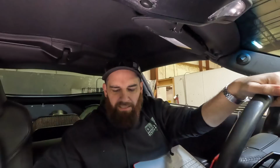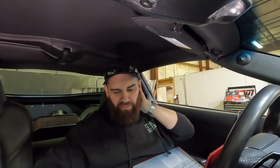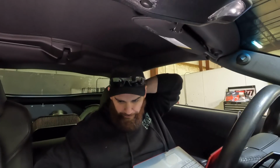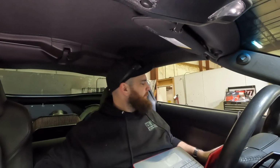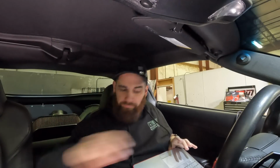All right, this is a 2012 base C6 automatic that we did an A&A kit on. And obviously from Connecticut, everything that came with that. So injectors, booster pump, etc. It baselined 413. So it should pick up, just pump gas, no meth, it should pick up 150.